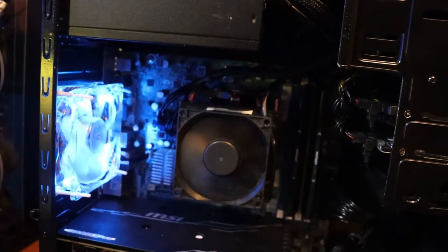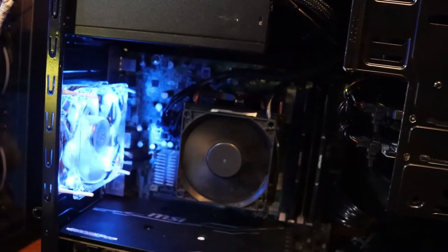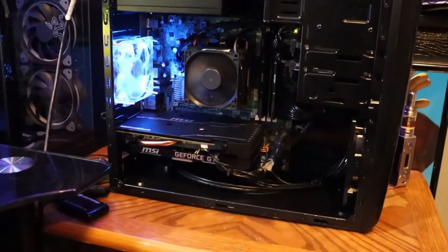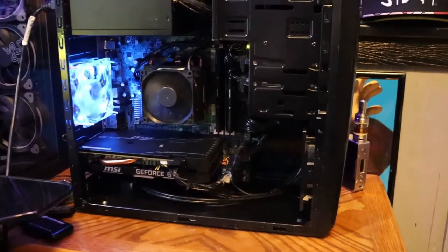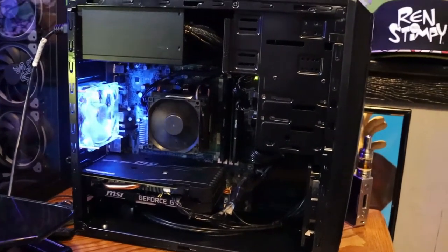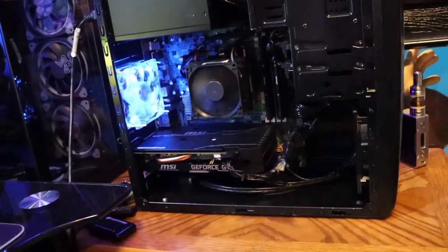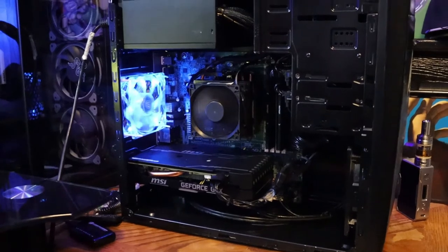And then after I painted the power supply, I again tested, booted into BIOS. I didn't have a hard drive, so I didn't bother going into Windows, but after that, it would not go into Windows even with a hard drive. With the thumb drive, it didn't want to boot. BIOS kept giving me an issue with the battery, and I figured the battery was just old. It should be fine and still be able to boot. Troubleshot it by trying another battery.